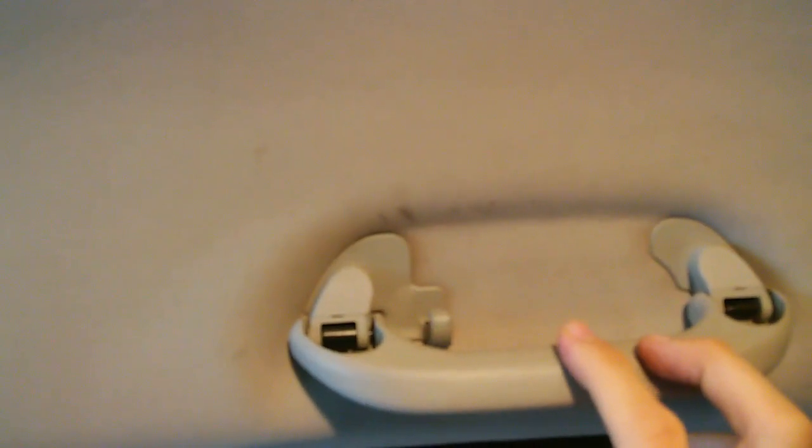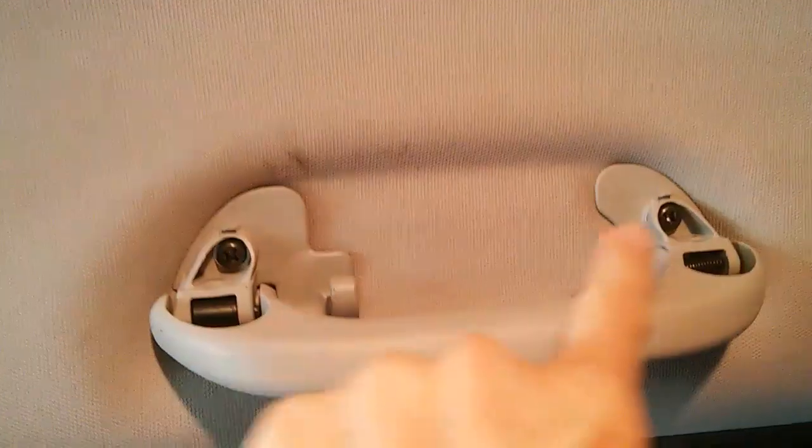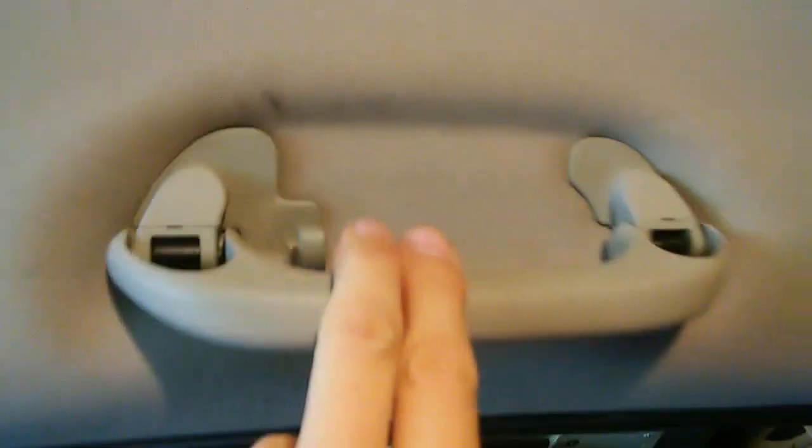I've gone ahead and reattached the two lift handles, the back seat lift handles, right and left. Before you tighten down the screws on those lift handles, be sure to line up the trim with the weather stripping properly. You can get it lipped over or lipped too high. Once you tighten down those screws, it's hard to adjust this thing. We put our little caps back on as well. Okay, we pop them on. Good. We just do the same thing on the other side.